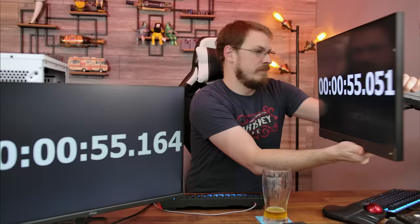Editing Jeff here — he's the personality and I'm the talent. He wasn't smart enough to get a wide enough angle lens to capture the full time scale on both monitors at the same time. Luckily, I was able to catch one single still frame with one second clicking over to the next on the KVM monitor and the other second having already advanced on the HDMI monitor. From best I can tell, it's about 100 to 130 milliseconds of difference. There is some latency in the system, but it is far better than pretty much any other remote management system I've used in the past, including a lot of IPMI connections. Editing Jeff definitely approves of the latency inside the TinyPilot.